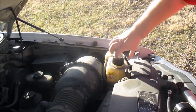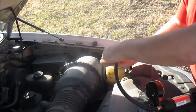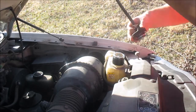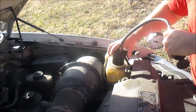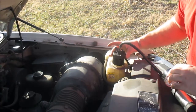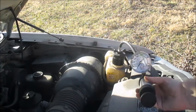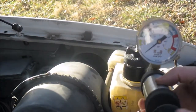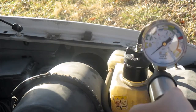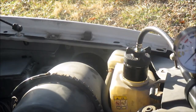You can squeeze the radiator hose — if it's really hard, that means it's under pressure. Barely crack it slow, and if you see pressure coming out, it's under pressure. Mine's not because it's been sitting, so I'm going to take this cap off and screw in my adapter. This is plastic so don't wrench on it. This puts it under tension so you screw it on and pop it off — it sucks it down. You screw it down until it back-seats and touches the tabs and won't go anymore, then back it off and it holds it tight.